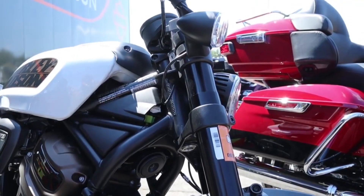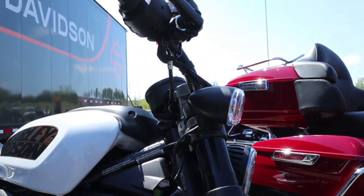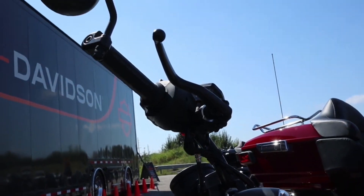The other thing was the suspension — it's firm, especially in the rear. But it doesn't bottom out all the time, even though it's got a couple inches of travel. I didn't expect the suspension to be good. The stock configuration has 3.6 inches of travel in the front and 2 inches of travel in the rear — well, that would be why it's pretty firm.